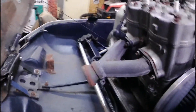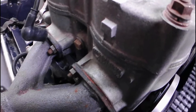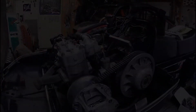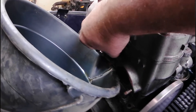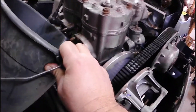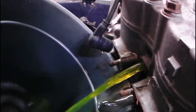I've already got the exhaust out. Nice thing about a TXL is right here is this drain plug. So I'm going to pull the Y pipe off and proceed to drain this into a bucket, remove the clutching, and remove the clutches, hoses, and wires and get that motor out. A lot of people have owned these motors over the years and they love them — they start easy, they make great power for a 340, they're easy to work on, and they always seal up nice and tight. You don't necessarily have to make a huge mess with your anti-freeze with that handy drain plug. We'll pop this radiator cap loose and there we go.